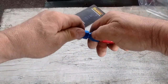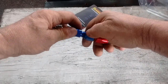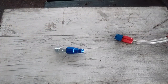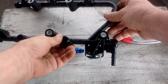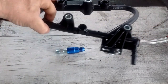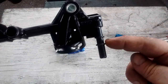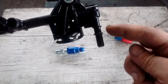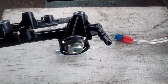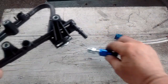This is all pretty standard stuff and it's really not the reason I'm doing this video. The reason I'm doing this video is that we have a special situation with the 2GR fuel rail. This is a 2GR fuel rail. If you look, you see that the fuel rail has two flanges, and it also has this square cutout right here. This gives rise to a little problem.